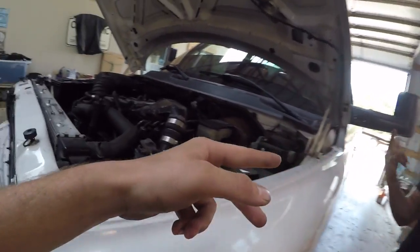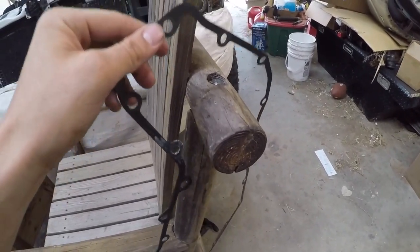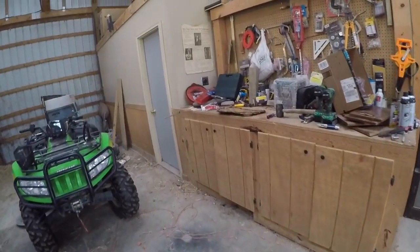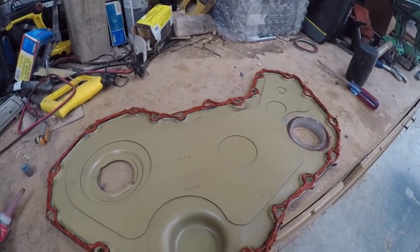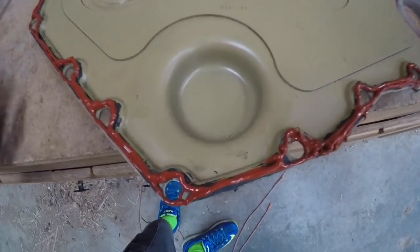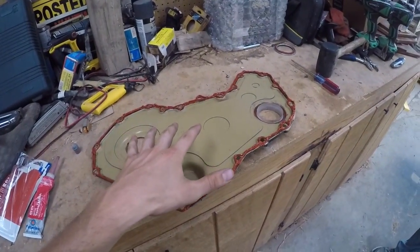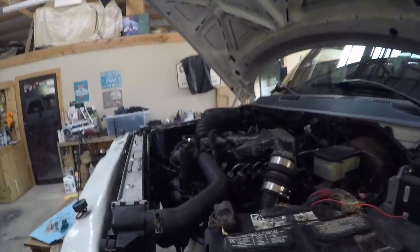We got Joshua here and we're about to put the timing cover back on. I'm not going to reuse this old gasket — when I took it off originally, it didn't have one of these anyway. All it had was this gasket maker rubber sealant, which is extremely heat tolerant. I put a good amount of that stuff all the way around, so we should be good. That's all that was on there before. If it doesn't work, there's always part four — totally kidding. Let's get to installing this.